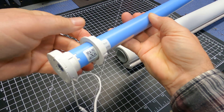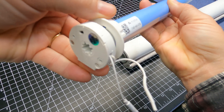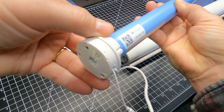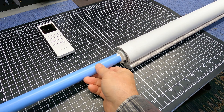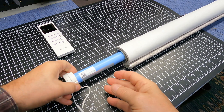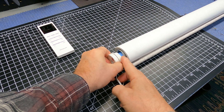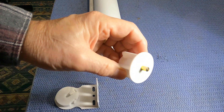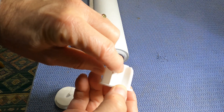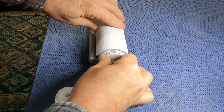Installing the smart motor into your existing roller shades is straightforward. The roller motor has notches that align with the inside of the shade tube that you insert it into — the motor just slides in. Then the cog fits in the other end and also aligns to the notch inside the tube. These roller motors will fit any length 36 or 38 millimeter roller tubes.